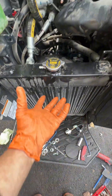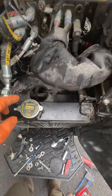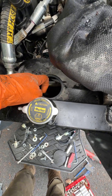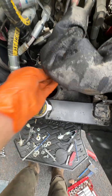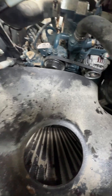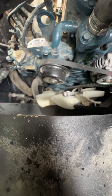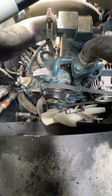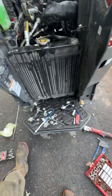One, two, three, four — and you pull this whole thing forward. This hose is all curled up, so you're not going to be able to get a lot of clearance here. But you can take this cover off this little hole. What I ended up doing is I got in here with my hand, took the radiator fan bolts loose, and just laid it in there. It's going to be a bit of a challenge putting that back together, but because the fan belt's still on and there's still tension on that pulley, those holes should all still line up easily. I'll get them all started by hand and then reef them down with my 90-degree.